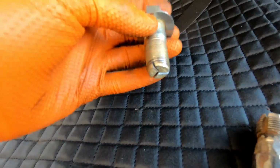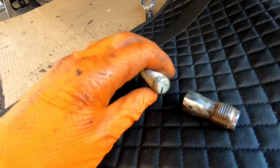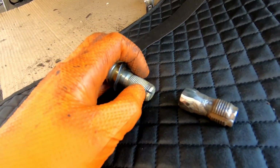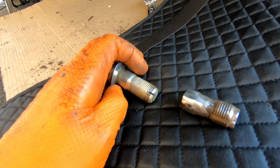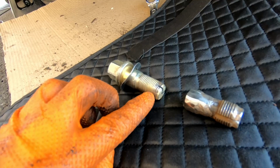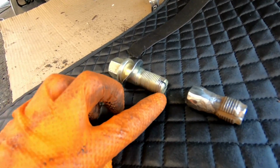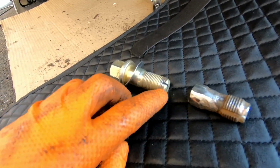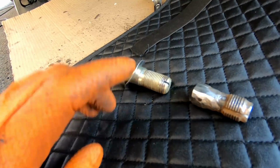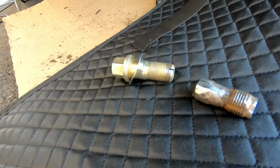And then for the bolts themselves, actually, because I couldn't get this going the whole way through, I've had to cut some kind of relief into these so they can self-chase the last few millimeters. The actual hold on the thread is from about here backwards, so you know this peeks out the far side anyway, so that should be fine. Got one side in, just have to get this one in as well, and then we are good to go.